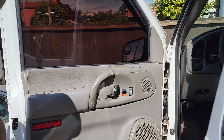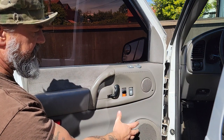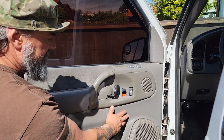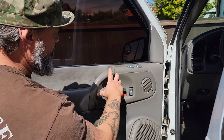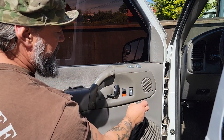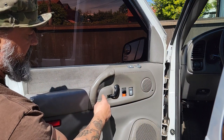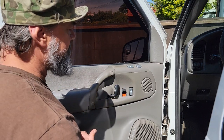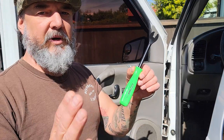This is not going to look the best because the sun is hitting this. I've got to pull this whole panel off the door — door card, sometimes they call it. I was sent one of these as a replacement for this one because this one is all cracked and busted up. You have to pull the bolts from here and pull this handle off — it has some screws in it. This disconnects from here; you can leave it in place or disconnect the fittings for these buttons and pull that off. This cover has to come off, then the whole panel comes off. There are a bunch of white plastic clips and it can be a little difficult at times. If you don't have one of these clip removal tools, go get one.